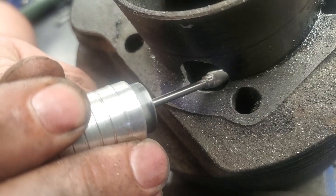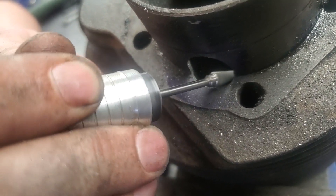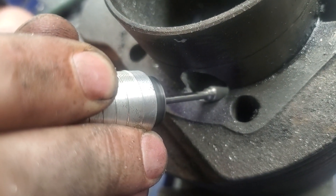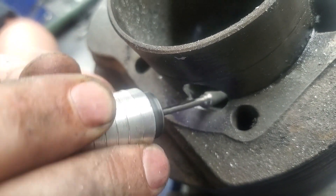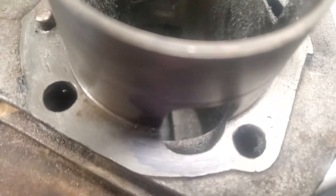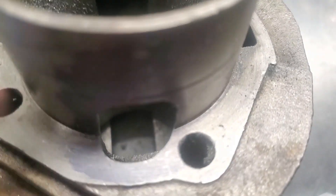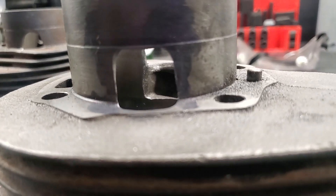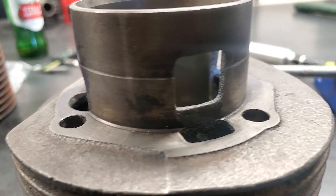Here you can see the hole above the existing port, and now with a grinding rotary tool — be it a Dremel or whatever you have at hand — we grind open the port and basically create a case port for this P200 stock cylinder. After the initial rough cuts, they do look pretty good to me. I will go in there with a 90-degree tool at some point and clean up the internals.